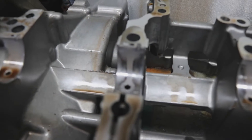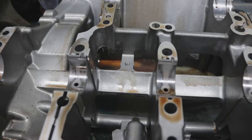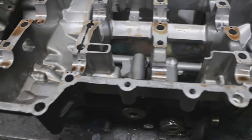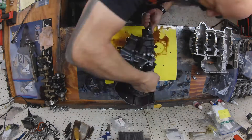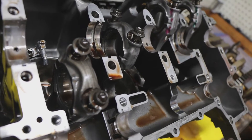Really low RPM, high load stuff — a lot of launches and taking off. But still, no heavy streaking or debris marks or anything like that. Really good oil changes, lots of oil changes. Not burning up any clutches helps with all that. Because inline fours, you can run pretty lightweight oil. When we raced the Aprilias, we learned real fast — you had to have thick oil in there. Anytime I do twin stuff, 20-50 oil, thicker weight oil, is when I generally have seen issues like that. We also found out that zero weight oil, although it may be fine with rods and main bearings, is not good on transmissions.